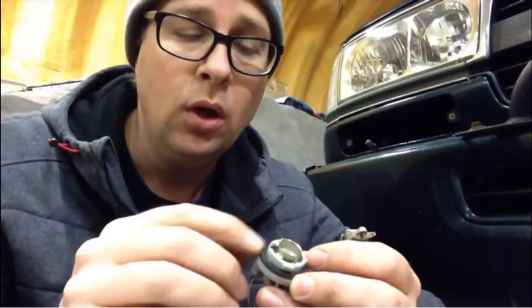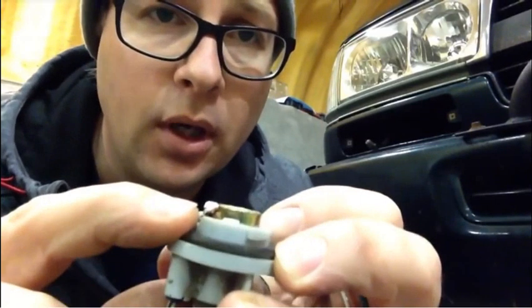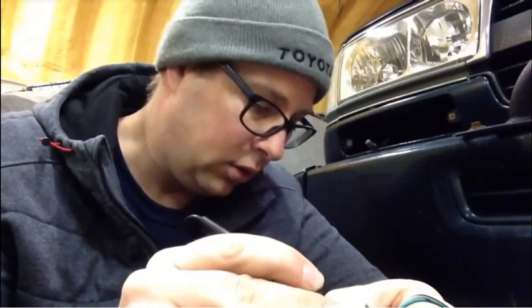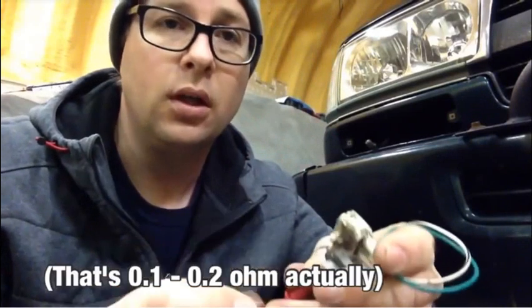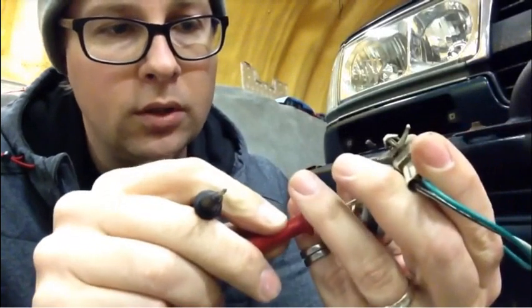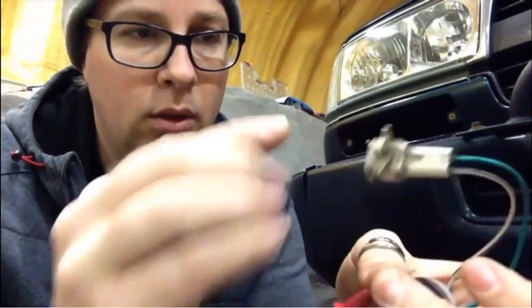I found the problem where the wire wasn't connected — it was just shoved in beside the socket. When I pulled the wire, it just broke off and came out; it was pretty corroded inside. I stripped a little bit of wire off, got a new clean section with no corrosion, and I've soldered it to the bulb socket right there — soldered to the outside. It's going to be a much better connection. Before I put it all back together, I'm going to check it. With my meter on ohms and tone, I'm checking the outside pin — I have a tone now, and I'm getting just over zero ohms, flashing between one and two. That's a good connection. I'm checking from the outside of the socket to the pin in the plug — it's good. And checking the center pin as well: good on green. So now this piece is working. It should all work when I put it back together.